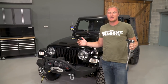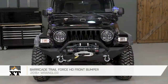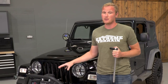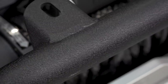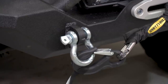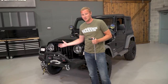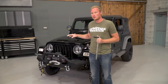The next big upgrade James made on his Jeep was to swap out the front bumper and also add a winch. Up here, he went with the Barricade Trail Force HD front bumper, which in my opinion is an excellent choice. It's not gonna be an over-the-top flashy bumper, but it is going to have a lot of functionality that he's definitely gonna be able to use now that he's taking his Jeep off-road more. It has a bull bar up top with a couple of light mount tabs, allowing him to reuse his factory fog lights. It also has a couple of D-ring recovery points so you can attach a snatch strap or tow strap to get yourself out of a tough spot. There's also a spot to mount a winch right in the center without the need for any additional hardware — this is a winch-ready bumper.